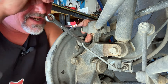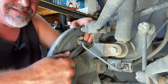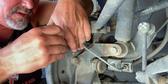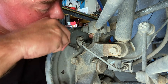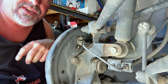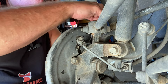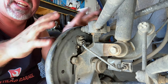Remember you're on the back side of a nut, so it's lefty loosey righty tighty — down is going to be loose. Okay, that broke free. Don't need to take it all the way off. Then with a 10 millimeter, go ahead and break loose both of those mounting bolts as well. Now, if you live somewhere where it snows and rains a lot, put some PB Blaster or WD-40 on those to loosen them up, but out here in Arizona we don't deal with moisture.